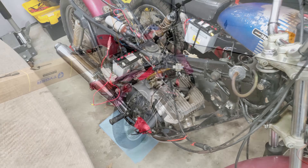We're back. I played with this a little — the new recoil spring is actually too big compared to the one on there, quite a bit thicker, so I don't think it's going to work. I did get the old one to work a little better. The previous owner said this o-ring is no good, so we're going to replace that. Before that, we're going to wire up the key cylinder. I have a key and a diagram — I'm missing the number one prong but number nine should be live whenever number one is, so we'll jump that. We'll put the battery in and see if we at least have lights and a horn.